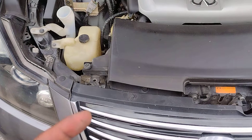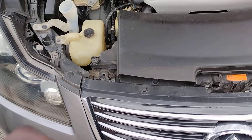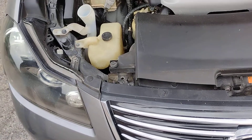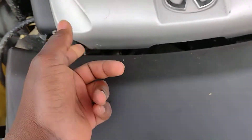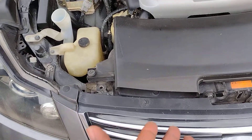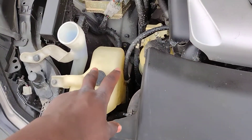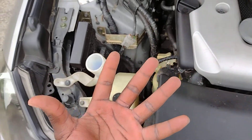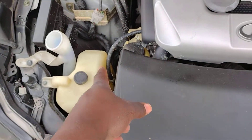The final solution is replacing the radiator — that's where the money is going. But meanwhile, to limp along, buy some 50/50 coolant from Walmart, the cheapest you can get, and fill it up. The car is going to keep consuming coolant until the radiator is replaced and you risk overheating. When the coolant system cools down it sucks coolant from the reservoir, so you can keep adding coolant there.